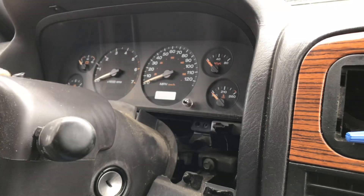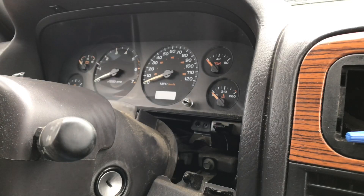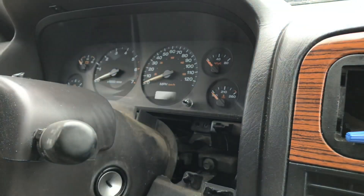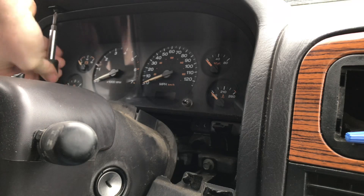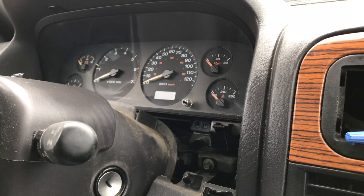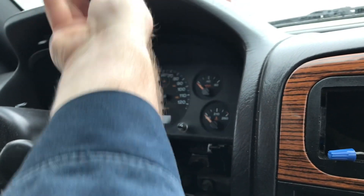This one over here — it's actually pretty tight for plastic screws. You're probably asking yourself, why would you have to take the cluster out of your Jeep? Well, for many reasons. If a light's blown, you need to replace a light. It's good to know how to do this stuff, because if you take this to a shop or a dealer, they're going to charge you all kinds of money just to take out four screws, which is unnecessary. So what you want to do is take a screwdriver — it's kind of real easy right here. It pops down, and that pops right out like that.